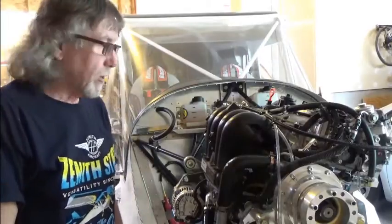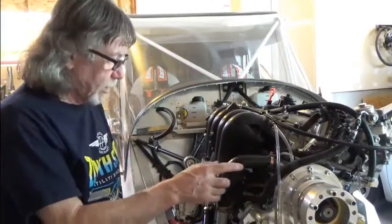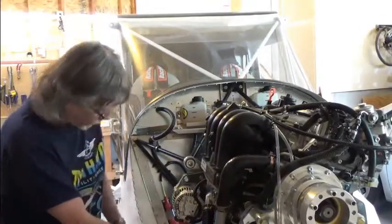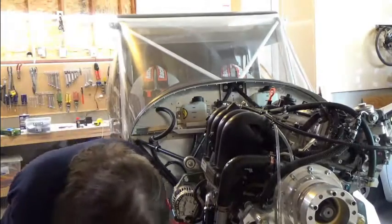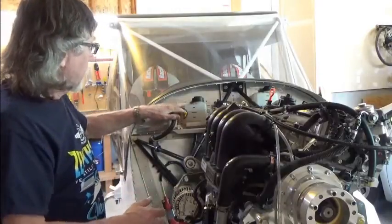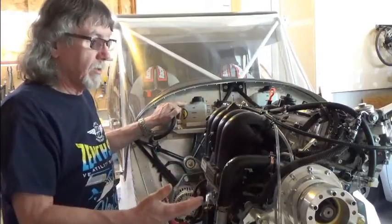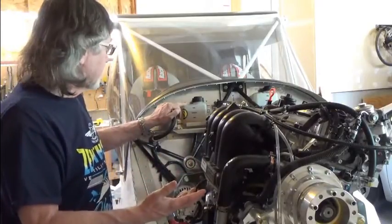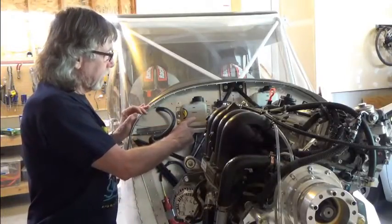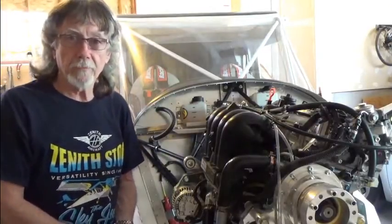Be sure and check for any leaks all throughout your system — check at the couplings and joints on your hoses, and check the radiator for any leaks. You can also fill your reservoir, and when you do your first start you can warm up the engine and draw into the cooling system whatever is needed. Finally, you want the level to end up just a little bit above the bottom line, as per the instructions on the HomeBuild Help video.